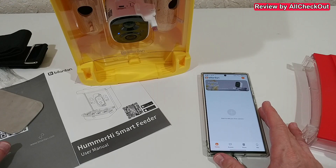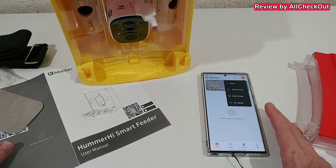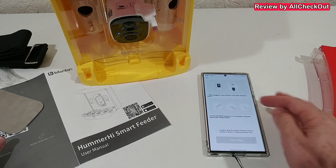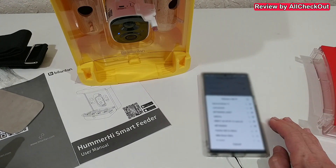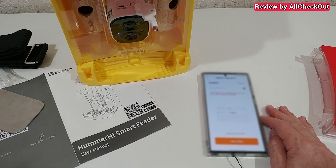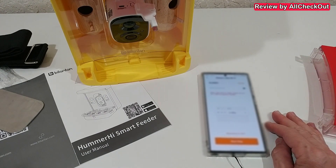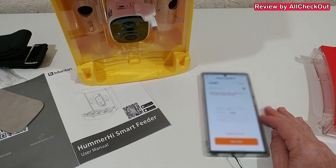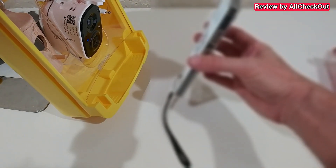In the meantime, open the app and set up an account. Hit the plus button for a new camera, click 'Add Device,' and select 'Battery Camera.' Confirm and click Next — it's very important to give all authorizations. Select the 2.4GHz network and make sure your phone is already connected to the same 2.4GHz network. After connecting to the camera, you can switch to any internet access — 3G, 4G, or 5G — from anywhere in the world. This step is just for the initial connection. Then we get a QR code which we hold in front of the camera.